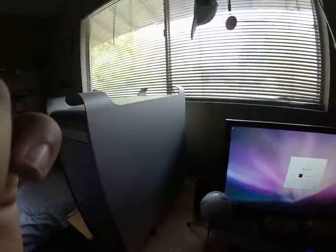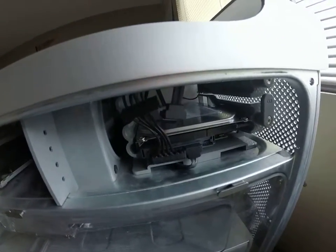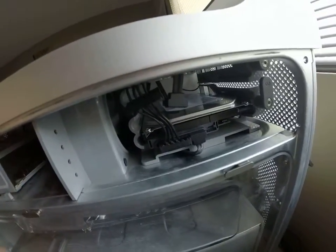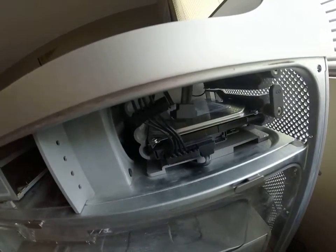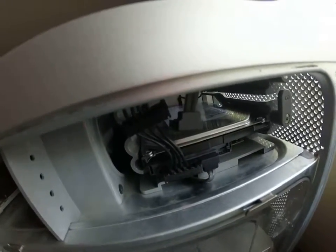What I did was I moved the hard drive into slot B. You can see there's a primary slot and a secondary slot for the hard drive. I had the hard drive in slot A, and as soon as I moved it down to slot B everything worked fine — problem solved, everything was perfect.